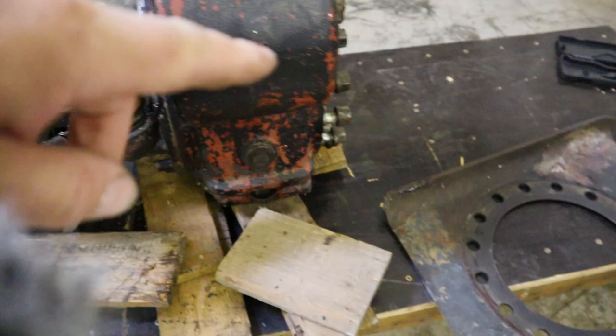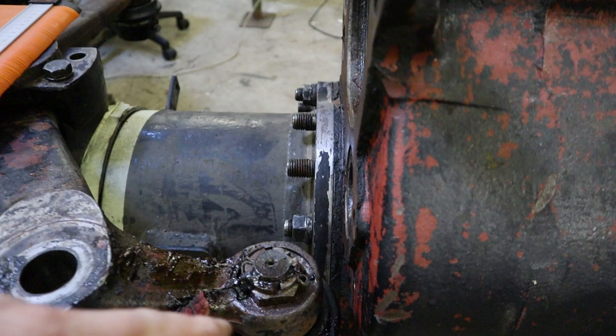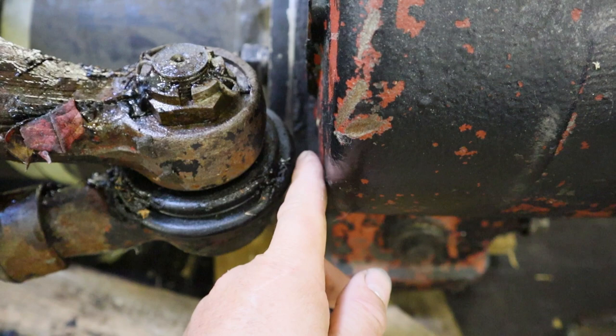First thing I'm going to deal with is this tube over here. And because we are going to put this plate there, we want this part as short as possible, so I will cut it over here a little bit more. And also here is some gap over here. I think we can make it closer to get this part even shorter. So let's go.